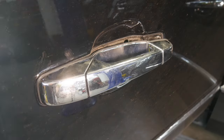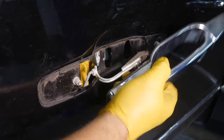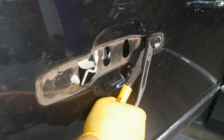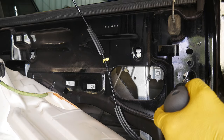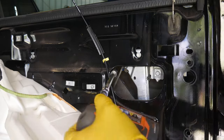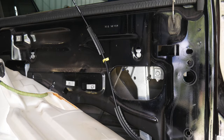Take the 10 millimeter and back that bolt out, but before you do that, put some pliers on the other side where the pieces have broken off. On this one both sides are broken so I can just pull it out — you can see our handle rod right there. Work it off that elbow carefully so you don't scratch the vehicle. Put some pliers on both sides to back off those nuts. Once they're broken free you can get in there and remove them — there are the broken nuts; discard those. Now we're ready to put the new one on.